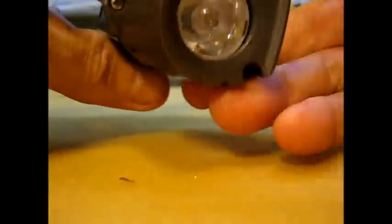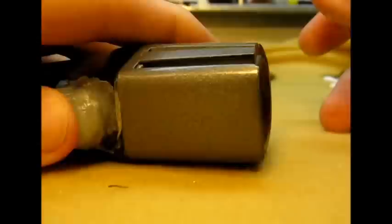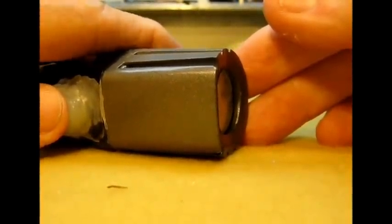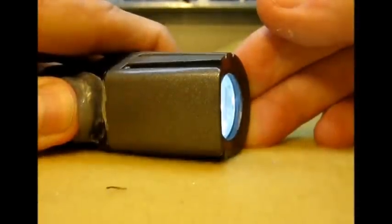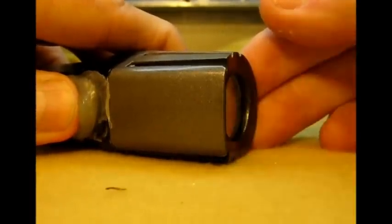Now it's basically together — relatively clean lens. The lithium battery: it's always good to give the contact surfaces a wipe with a little metal polish or with a Q-tip. It's nickel plate, and when nickel oxidizes it's not a very good conductor. So the battery goes in and the light comes on automatically. Now let's see if the light functions properly: medium, low, flash. Press the button in all the way and hold it for a second and it turns off. If you want to turn it on and have it go into low power mode — to use as a general purpose low power flashlight — it'll run for 20 or 40 hours at this brightness. That's your SOS. Press the button and hold it for a second and it turns off.